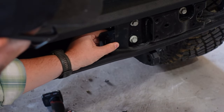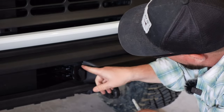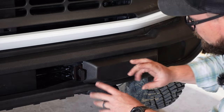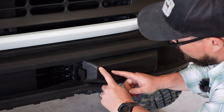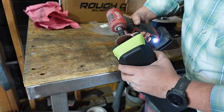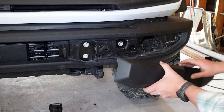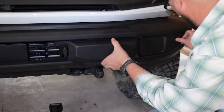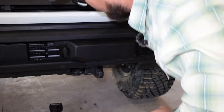On this bracket here, you can see these dimples. I'm going to use this and they're going to be flush right up against this. I've got some coarse thread stainless steel screws that I'm going to use and they should bite pretty well into that plastic. And there we go — got that all mounted nice and tight. We've got some marks made here. We're going to notch this out. And obviously if you have fog lights or anything down here, you might have a little bit of a different setup. Perfect — like it was made for it.